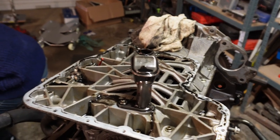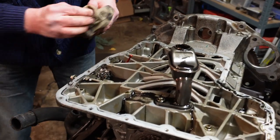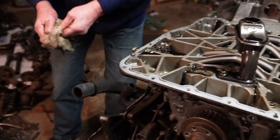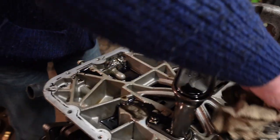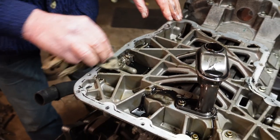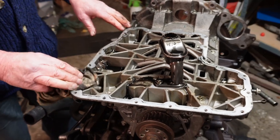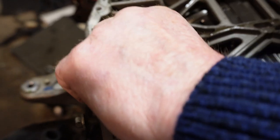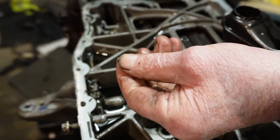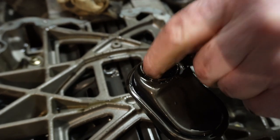We'll take the dipstick out. This is what they call your ladder rack — this part here fits in between your cylinder block and your oil pan, and it basically strengthens and stabilizes the cylinder block. The reason this is needed — oh look at that, lots of metal filings there! They always fail on this bottom end. In here, that's metal filings everywhere, and it still turns over.